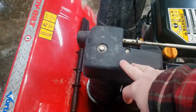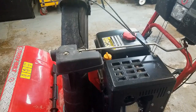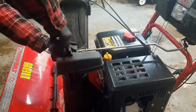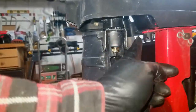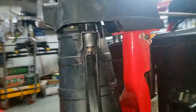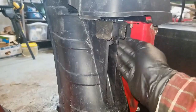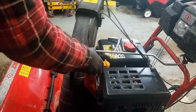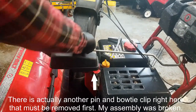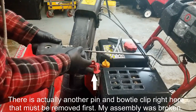So we're going to get into this and see if we can fix it. This is a half-inch bolt, so I got that out, and underneath here there is a wing nut which we're also going to loosen and remove. Now this whole assembly comes up. Next thing we're going to do is take this cotter pin and remove that from the shaft.